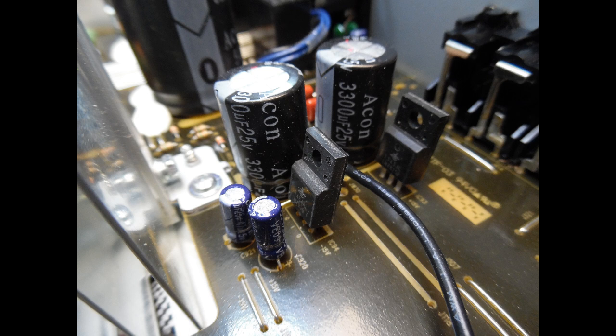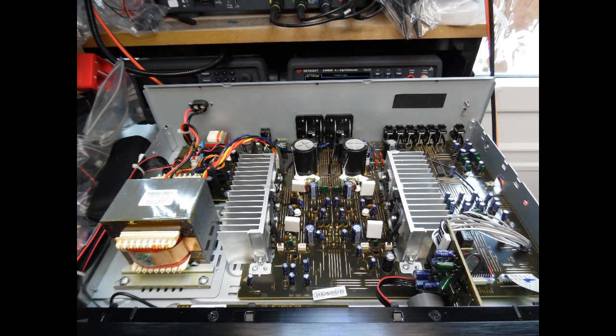This is the bit that's not documented in the operation manual. If you press the Direct Mode button and the Speaker Protection B button simultaneously, within a few seconds the amplifier will reset the protection circuit and the power LED will change to blue — just wait a couple of seconds. If it's a soft failure where the amp detected something and went into protection mode but there was no physical hardware failure, the amplifier will just reset, the appropriate LEDs on the front fascia will illuminate, and operation will be normal.